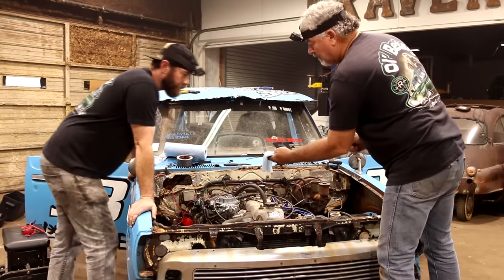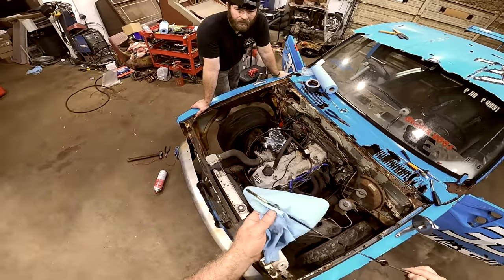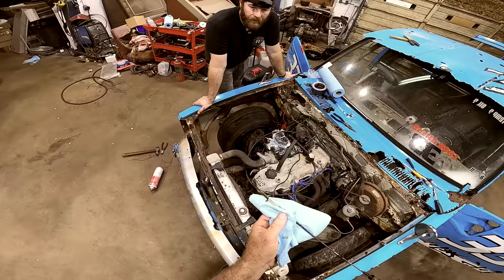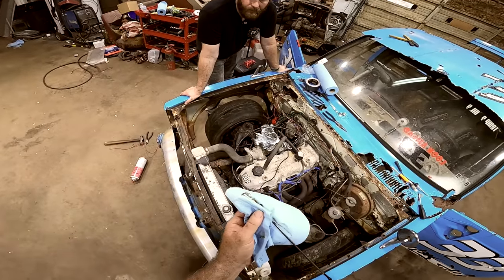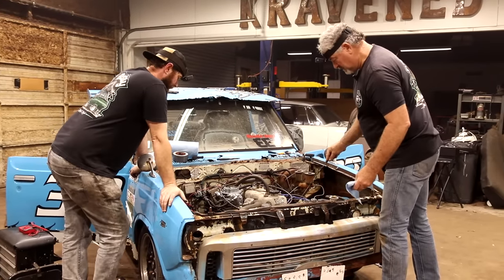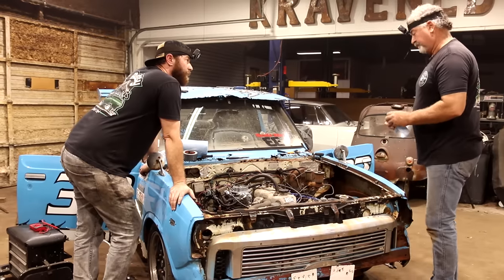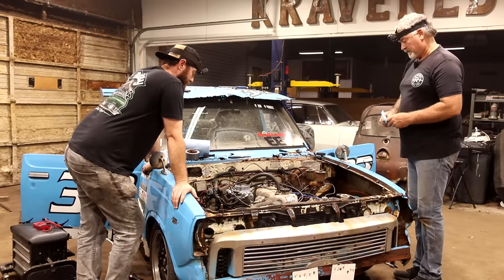Which we can top off the coolant. Ooh. It's a little, ain't it? Yeah. I mean, it's not clear oil. It's right. Let's top off the radiator, hook the fan back up, and kind of keep an eye that we're, you know, circulating, right, not losing water, and be sure we don't have a blown head gasket.